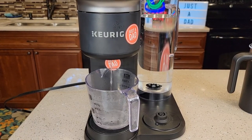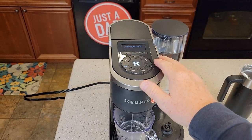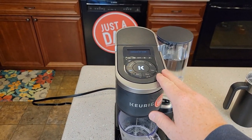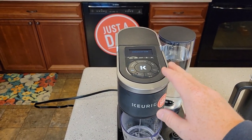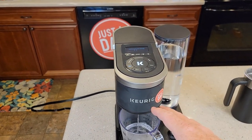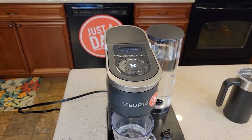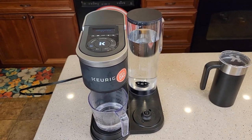So I've got this one back up and running and it looks like it's working really good. I think there's an important step when you're descaling it — letting it rest for 30 minutes. Check out that video; I've got a video on how to descale this with the Keurig descaling solution and the vinegar. You can use either one, but in between the descale and the fresh water rinses, you do want to let it rest for 30 minutes. It kind of lets that heating element cool down. So I hope this video helps. Thanks everybody for watching.